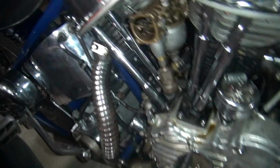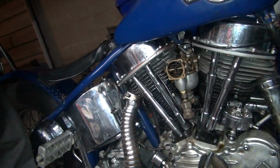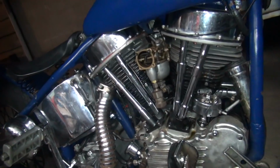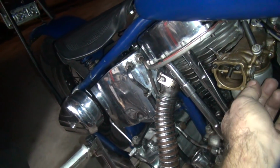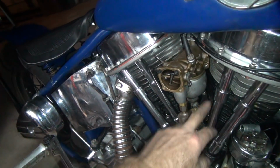Maybe it ran out of gas. Definitely got gas issues in the carburetor. Shut the ignition off. It's got to be on full choke to get enough fuel in the motor to make it run. And you see how it wasn't really. It started puffing slightly when I went on 3/4 choke. I saw that. But if I go over here, it runs pretty good. It actually ran. It ran out of fuel. Yeah. I'm guessing it's running out of fuel.